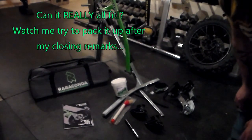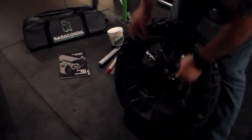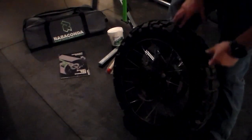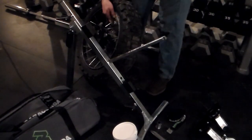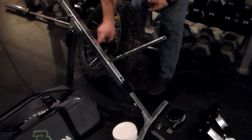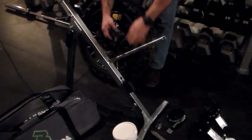So let's go ahead and get started. Just like any tire change, the first thing you want to do is take the guts out of your valve stem and drain the air. After all the air drained, go ahead and put your tire on the machine. You're going to have a couple of magnetic pieces here — good strong magnets — and you're going to slide these up and down to where they rest right on the edge of the wheel.